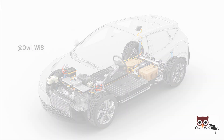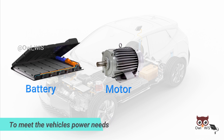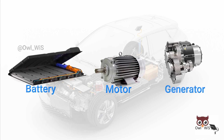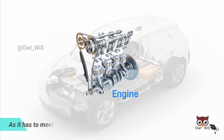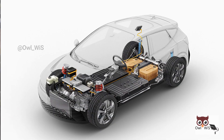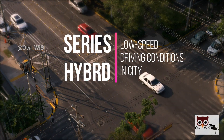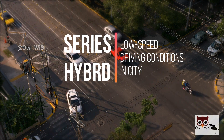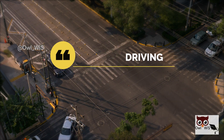A battery and motor with large capacity are needed to meet the vehicle's power needs. Along with the generator, all together these add to the vehicle's weight and cost. The engine is typically smaller in a series drivetrain. All these characteristics make series hybrid electric vehicles more suitable for low-speed city driving conditions, but not suitable for highway driving conditions.